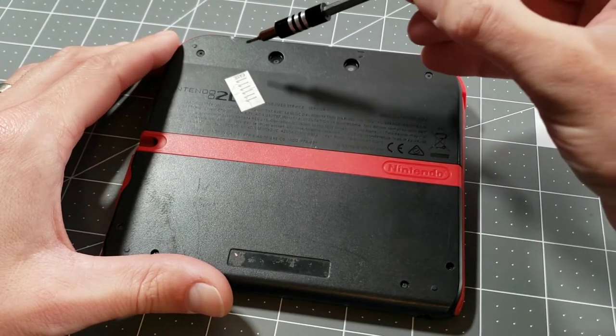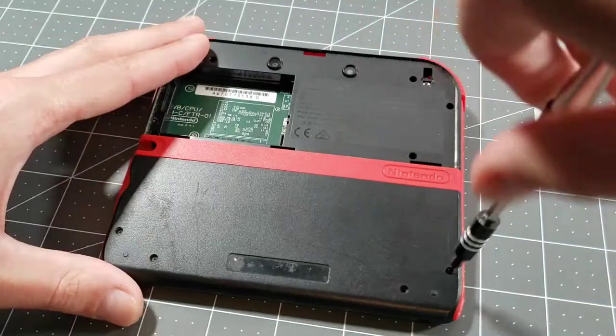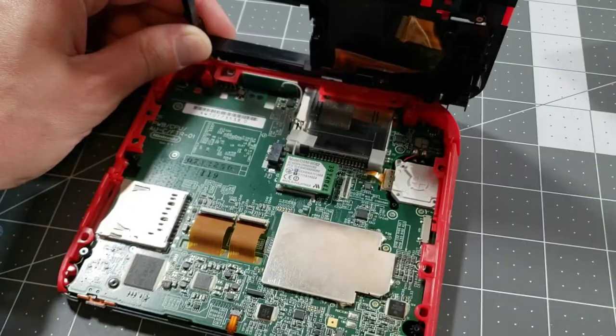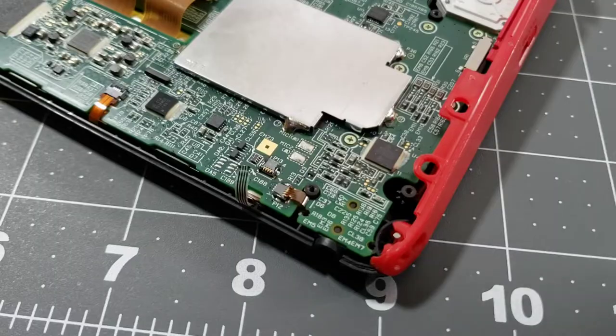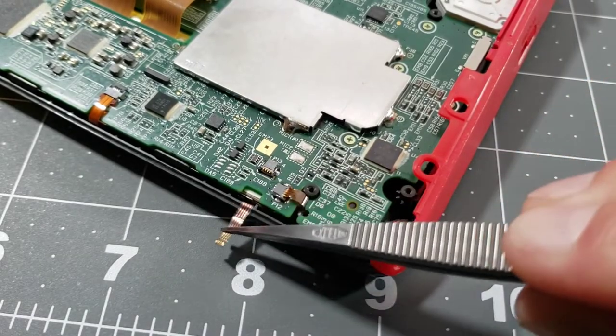Unfasten the upper two screws to get into the battery compartment. Remove the battery and there are 10 more screws around the perimeter. This is strange — the large flex cable under the back plate should be connected, but it isn't. Same story with the joystick connection, and even two down here. The one on the right looks like it's plugged in, but the cable isn't fully inserted.